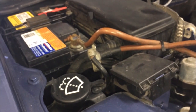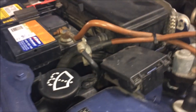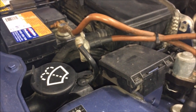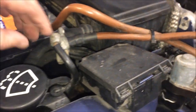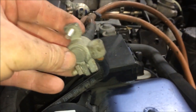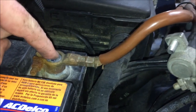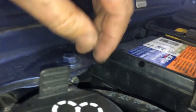Somebody did install this because there is a parasitic draw in this case, and that is the side headlights — the marker lights — they just stay on. So what I did is I took a look at the ground. This is the normal cable — have a look. There's the post, so this section right here would normally be going there. This is your regular negative cable right here, and it goes right underneath here.